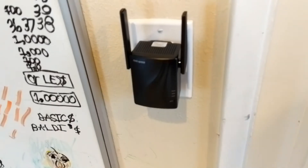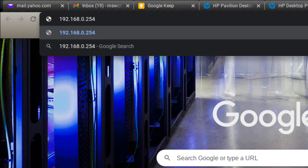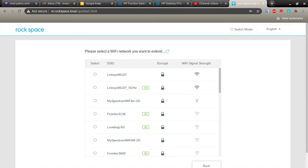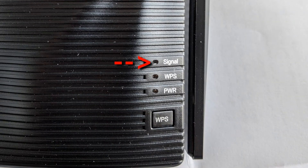Find an outlet near your router and plug in the repeater. Find the Rockspace network and connect to it. Once you're connected, open up a blank web page. You can either enter the IP address of the repeater, which is 192.168.0.254, or you can type in the web address which is http://re.rockspace.local. The first page will ask you to create your login password. Now you'll need to select your router — I'm extending the 5 gigahertz band so I'm going to select the Linksys 5 gigahertz band. Enter your router Wi-Fi password and press the extend button. It's going to start extending and then it'll tell you when it's finished.